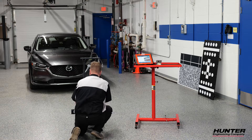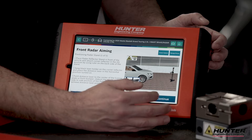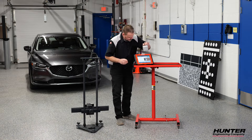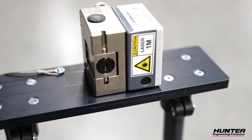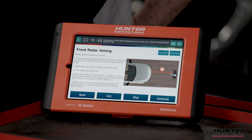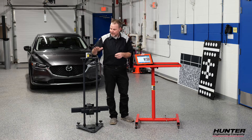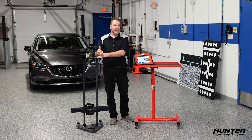It says to point the laser right at the front bumper. You can see it right there in the middle. Once I've done that I can press continue. There are five parts to this, so make sure you do each step one at a time — don't press skip. Now we're going to go ahead and grab our alignment laser and set it on top. We're asked at this point to open up the trunk, turn the alignment laser level on, and split the logos — I'm going to split the front Mazda logo with the logo on the trunk at the same time. This is where it can get a little tricky. We're going to get this stand level with the vehicle and also establish 5,000 millimeters away from the vehicle.